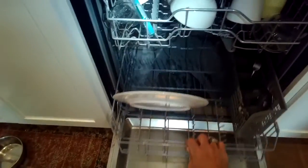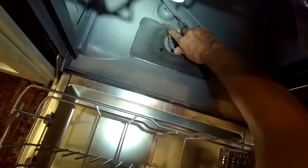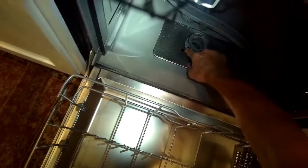One thing that's important is to always rinse your dishes so that the machine has less particulate matter that may get caught. And we want to make sure that this filter is always locked into position. To lock it, you just turn the filter handle until the two black arrows, sometimes they're blue arrows, line up. And you want to lift it and make sure it can't come off.